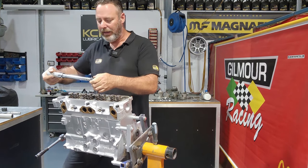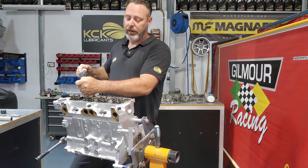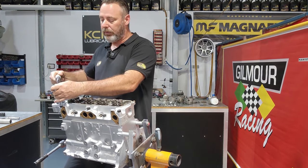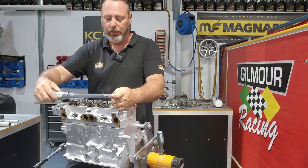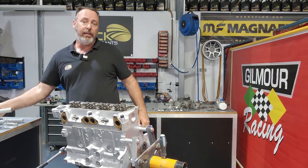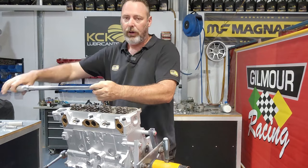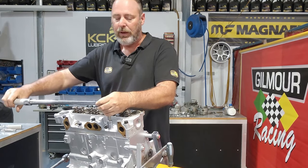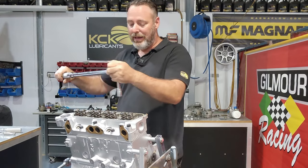Just as we're torquing the cylinder head down, it's a good reminder that it's critical to tap and clean out all the threads in the block and cylinder head. As much as the job sucks, it's really important. If there's been any machining swarf or garbage in the bottom of the bolt holes, the bolt would bottom out before it actually clamped up on the cylinder head - and all of a sudden we've got a blown head gasket and don't know why. The same goes for the conrods and the mains - it's just good housekeeping. That way when everything's torqued up, you know it's right. Now that the cylinder head's on and torqued down, we're getting close.